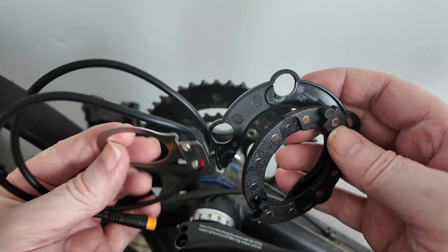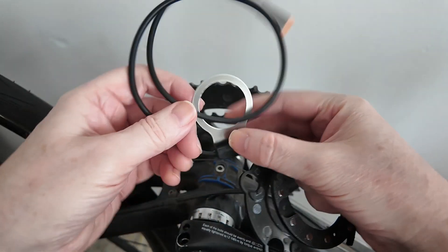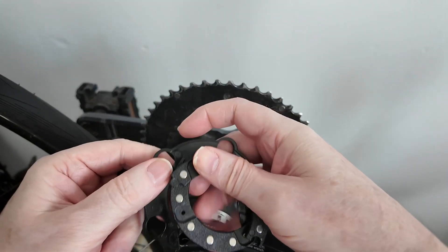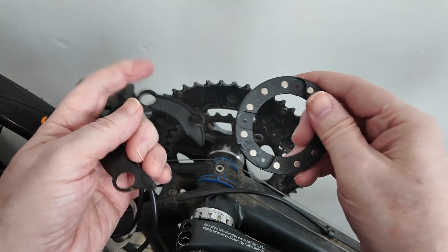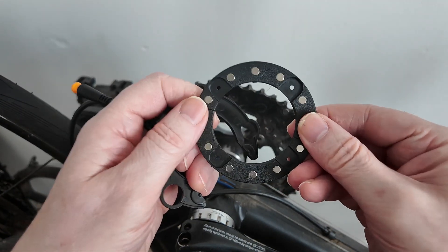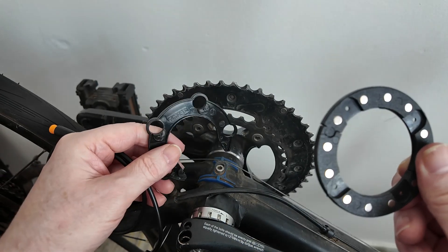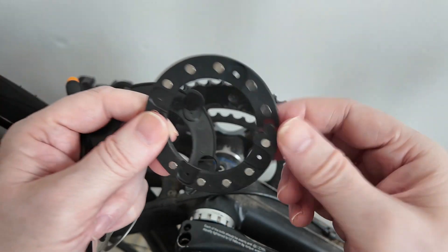This is the only right-side PAS kit I've seen, so I'll need to bolt that on there, something like that. It's going to be pretty close really. For me, I have a crankset with a 74mm five-arm setup with that chainring on it. I don't think I had any other choice — the only other option I could think of was changing to a square taper, the traditional type of bottom bracket, but then I'd need to change my crankset and everything.